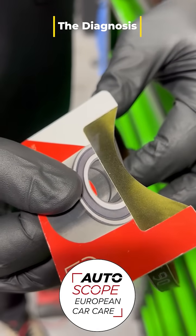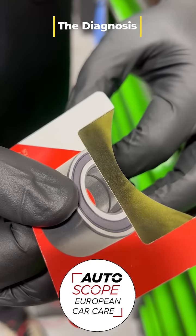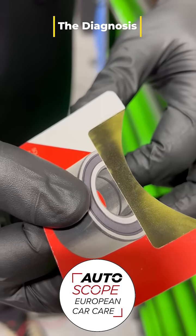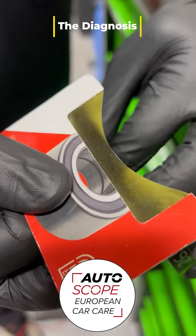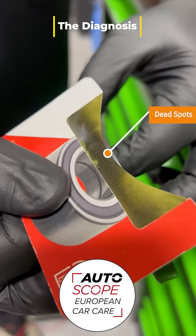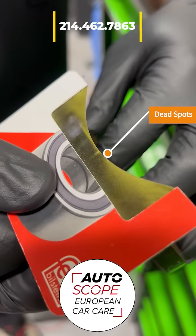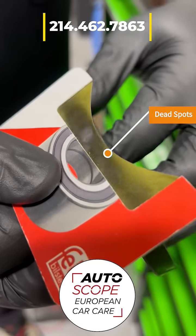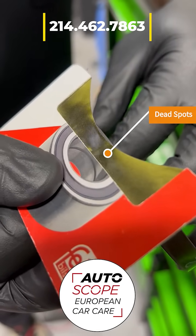Let me get back to where we were. It wants to see a big gap to tell the ECU that we're at the reset point of the motor — at top dead center again. But what this crank reluctor wheel actually has is two big gaps, when it's really supposed to only have one. Instead of a tooth, it has a dead spot here.